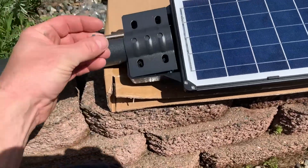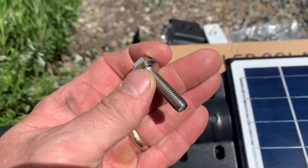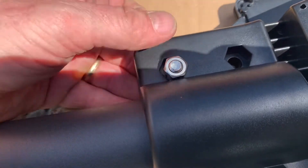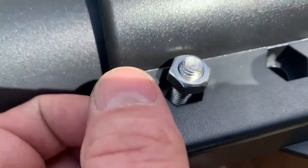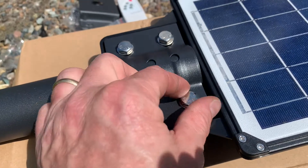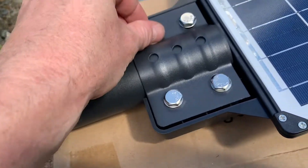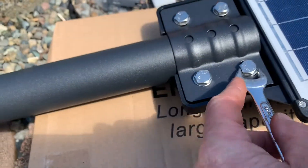Pull the remote out and put these on. I'm going to loosely put this in first. We need a washer — there we go — that's just going to go right down through here. Got these hand tight. The nice thing is you only need one wrench because these things tuck up in there, makes it easy. You can even do this with a crescent wrench. A 9/16 fits this well — crank them down with that.